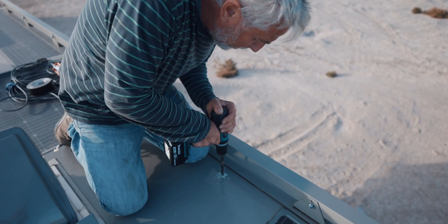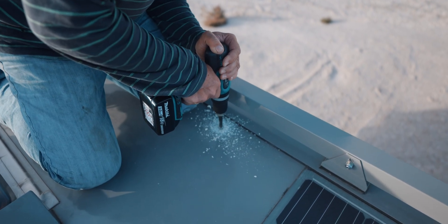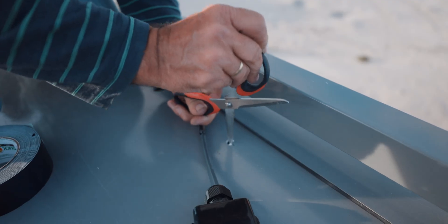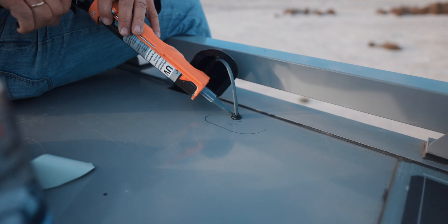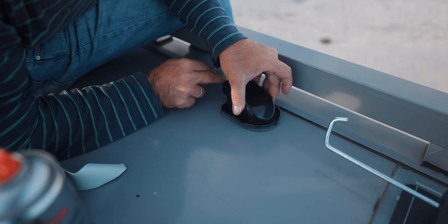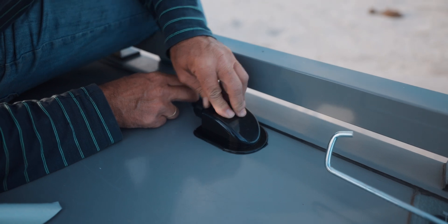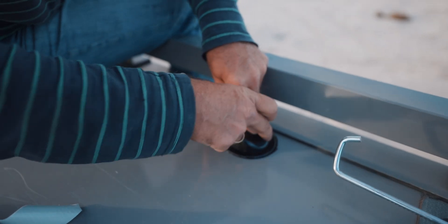After what felt like ten rounds of measuring and checking, the big moment arrives: the hole is in the roof and, luckily, also on the other side in the correct upper cabinet. We lay in a 12mm air duct as a cable pass-through and seal it additionally. Should the purchased cable gland be leaky and water collect in it, the actual inlet is still elevated, preventing water ingress. Then we glue the cable gland in place. The next day we taped over the whole thing with sealing tape to ensure absolutely no water gets through.